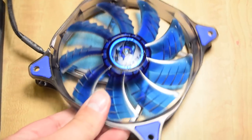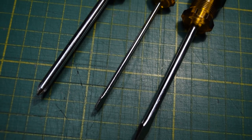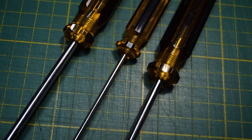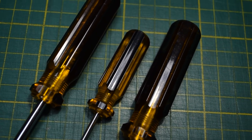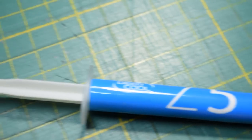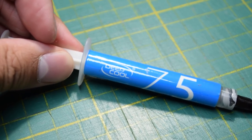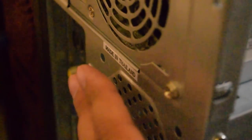I also have this spare LED fan for extra airflow out the back, mainly for the light. Here are the tools you're going to need — nothing special at all, mainly a Phillips screwdriver; a flathead isn't a bad idea to have either. I personally wouldn't worry about battery-powered screwdrivers, but the convenience of them is nice. It's always good to get yourself some thermal paste for the CPU — this ensures proper heat transfer to the heatsink by filling air gaps. Also make sure to get rid of any static electricity; I just touch a metal part of the computer that's plugged in.